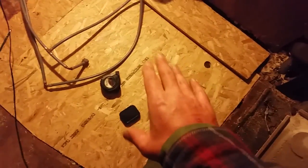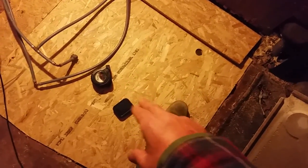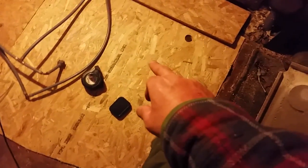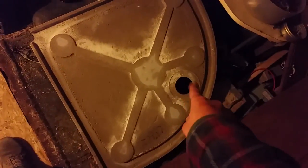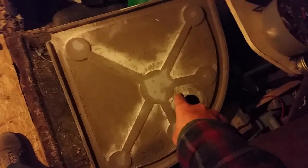This is sacrificial basically — it was free so I'm not worried. I've got to put in a hole somewhere about here because the shower tray will sort of be here, and then the shower tray hole — that's the bottom by the way — it's got to go down through there into the waste. I've also got to cut a toilet hole for the waste on the toilet, which will then drop down into the black water tank.